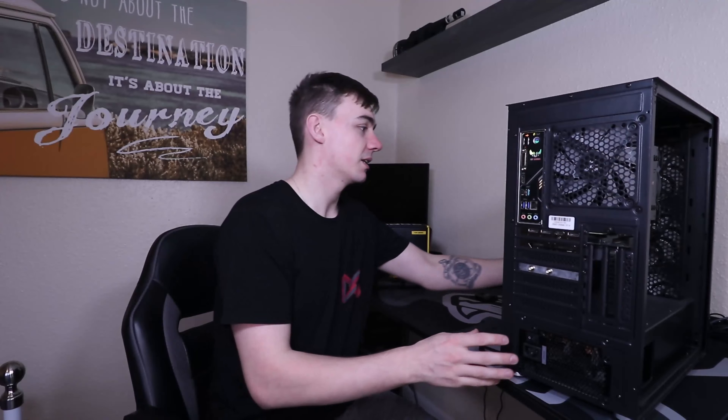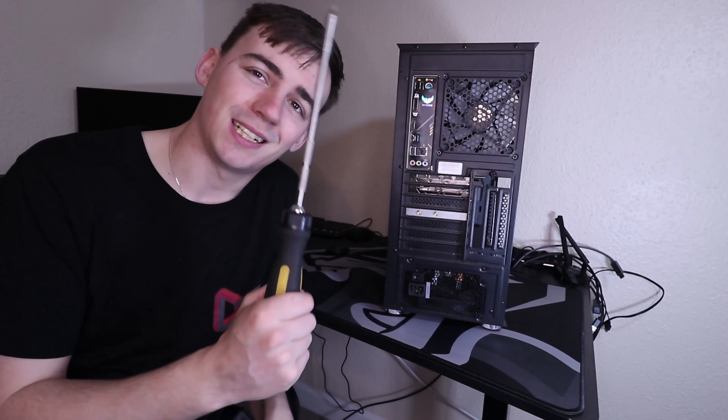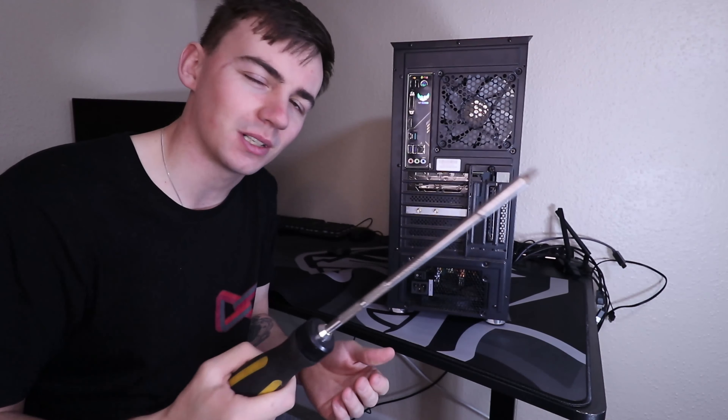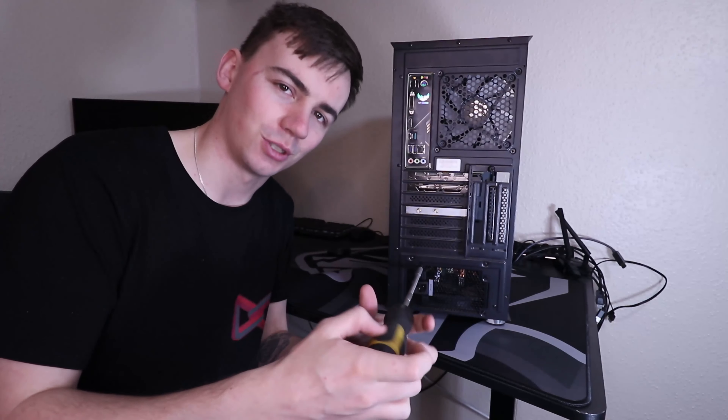So I've got the front panel off, as you can see, and I've also got the rear panel off with the amazing cable management, I have to say. What we're going to be doing is a teardown — getting rid of the old power supply, getting the new one in, and hopefully everything should go as planned. You will need a screwdriver, probably not one this long, but at least a decent sized one so you can get the bolts off.